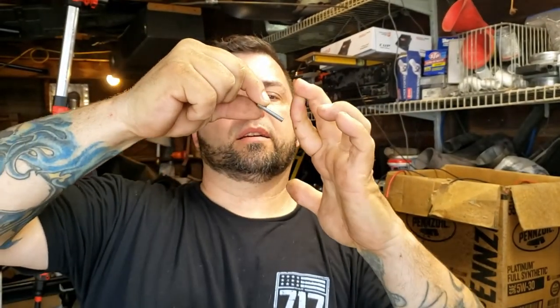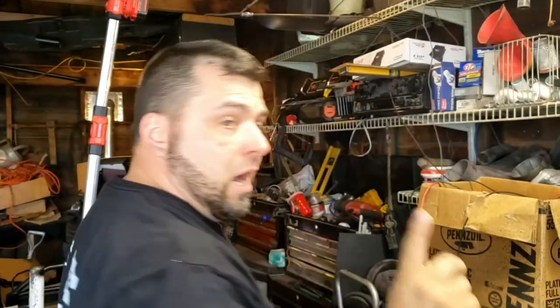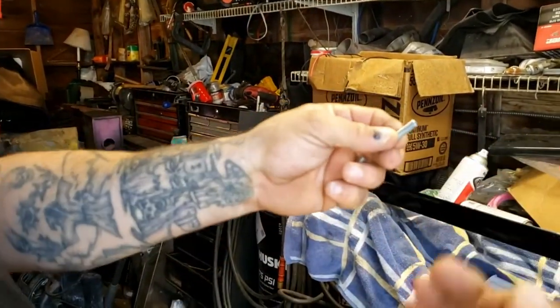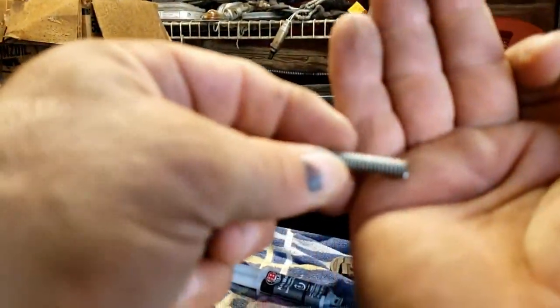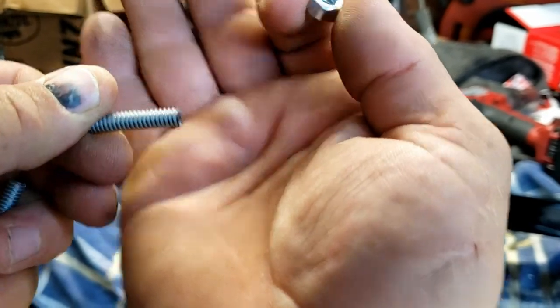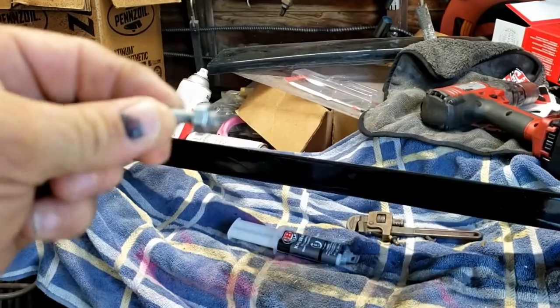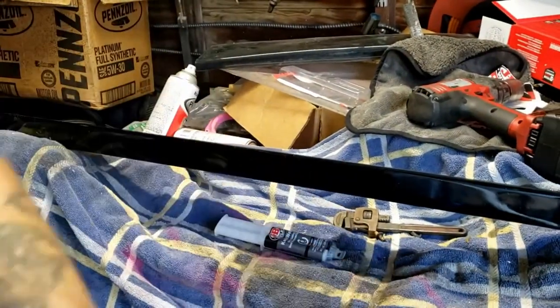But what you want to do is imagine that if this is the edge of the stone, you know, the curve, and it's spinning, you just want to take this at a little bit of an angle like that and clean that off just enough. And then that way when you go to put your nut on, it'll thread on real easy. All right, so here's what we got. Cleaned up those edges, so now when you go to put the nut on, it threads on real easy. We got one more to go here